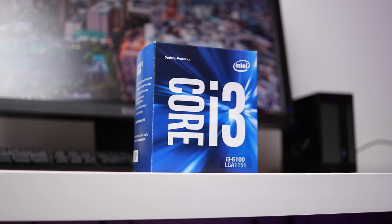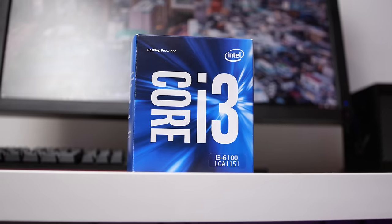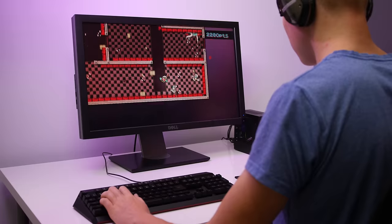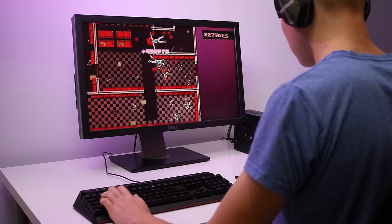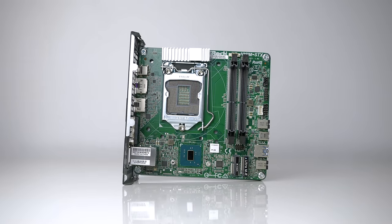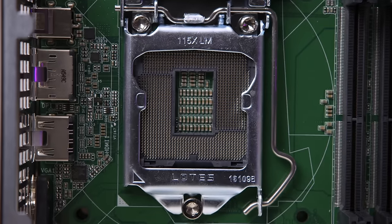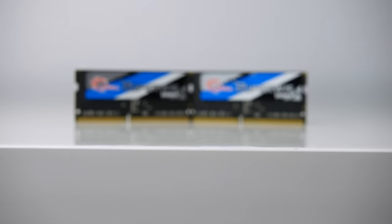The hardware in this build was chosen to be cost-effective, while still being powerful enough for light photo editing or some very light gaming. I chose the Intel Skylake i3-6100 processor, quite affordable at around $120, while providing good processing horsepower. Its integrated HD 530 graphics won't allow for much more than light gaming, but it's actually clocked higher than the one on Intel's more expensive i5-6400. ASRock's Mini-STX board measures only 5 inches by 5 inches, but will accept any 65-watt TDP Skylake chip — meaning an Intel i7-6700 could have been added to make this a processing beast.